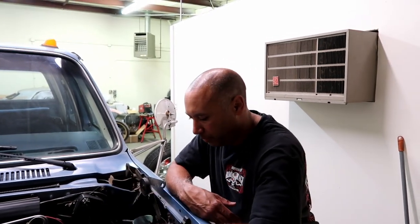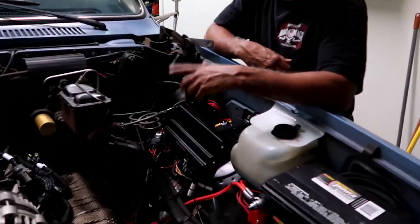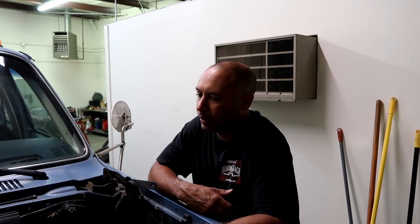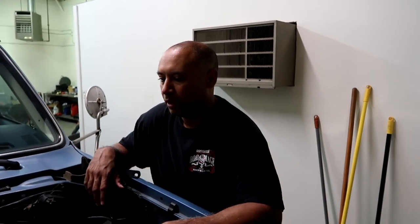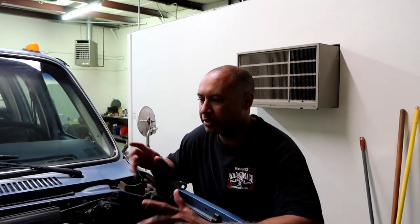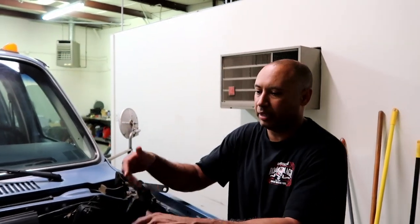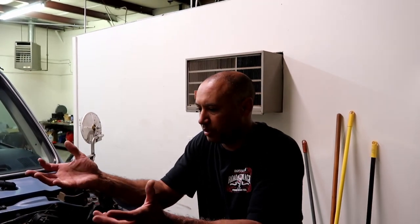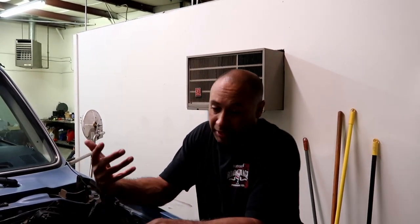We ended up getting the problem of the throttle position fixed. We called Holley. We were on the phone with the tech for a while. Basically, you have to go through and set everything up first before you go to that stage. So you'll set tire diameter, your timing at wide open throttle, your timing with no boost, things like that. So we had to go through and set all that, like basic cam specs. And once we put all that in there, then we were able to set the TPS, the throttle position sensor. So it worked like it should have.